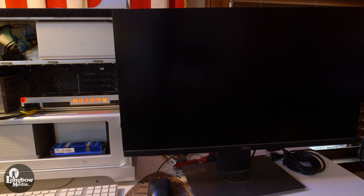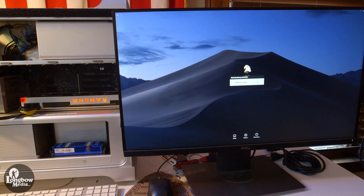As it was with the RX 580, there is no boot screen with the Radeon 7. Something new I've noticed with this card is that when booting up, the HDMI cable must be removed and plugged back in for the monitor to detect the signal after restarting or initially booting. I'm not sure if this is just a peculiarity with my system or if it's normal for these types of upgrades on a 5.1. Feel free to leave a comment if you know.